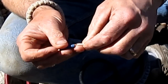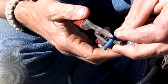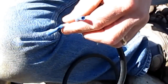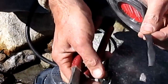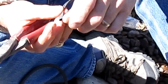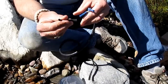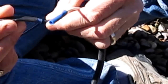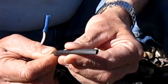Grab yourself a second connector, push it into the inside. Grab your crimpers again with the jaws facing to the sky. Push your wire back inside, push down again and give it a double push. Now take a little bit of your heat shrink tubing — enough to easily go over the size of your connector plus a little bit in addition, because you're going to heat shrink this with a small butane lighter. Go ahead and slide your heat shrink tubing all the way around your electrical connectors. It takes a little coaxing and a little pushing and shoving to get this to go through.